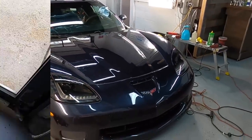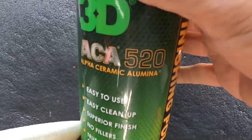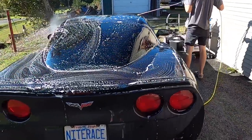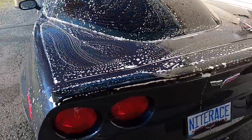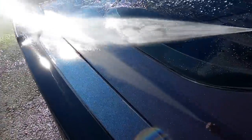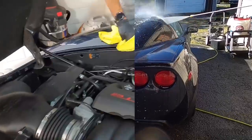As mentioned earlier, you can add another step depending on the budget of the package, or if this is your own car and you want to chase perfection, you can step down to a fine finishing polish like the 3D ACA 520 with a Rupes fine pad. After the correction, we're going to wash it down — there's polish residue and wet sand residue down between many of the cracks. We're going to wash the car and pressure wash between the joints, the panel corners, and freshen it up before protection is laid down.